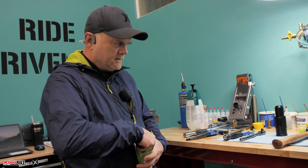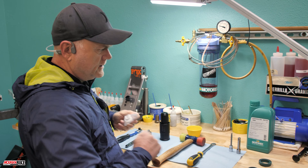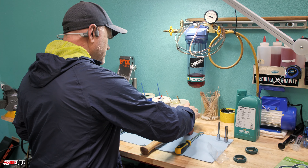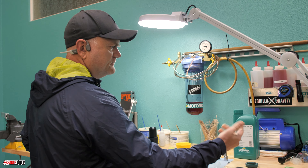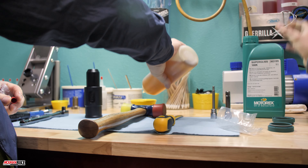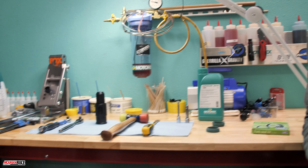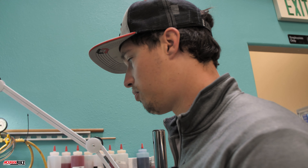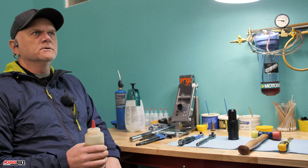Go ahead and throw the foam rings into the splash oil in a container — give them a bath, just in a cup like this. We're using Motorex Super Gliss for this particular build. RockShox themselves recommend Maxima — they have a couple of different versions — and it's all available, but we were unable to get it on short notice. The Motorex is very similar; it's comparable to Fox 20-weight gold, which is used in the lowers for Fox forks.